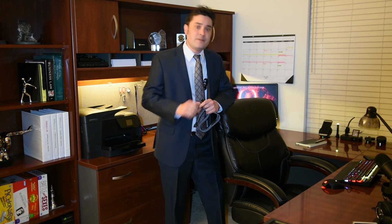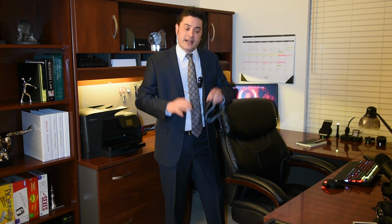Now, we got the computer set up, we got everything running, and really some cool stuff with this. We were able to overclock it, and we ran all the benchmarks, and we got it to about a 36-38% increase over the base clock, which is about 3 gigahertz, up to about 4.1. It probably can go a little bit more, but with the cooling we have and the length of time we ran our benchmarks and tests, I'm very happy with the results and very happy with where it runs under load.